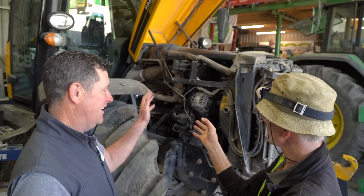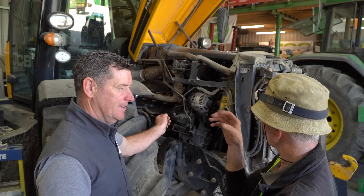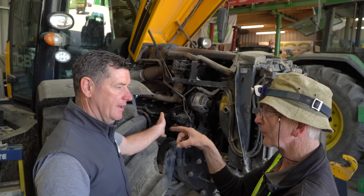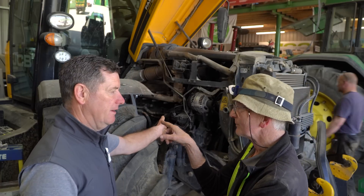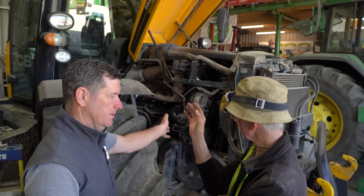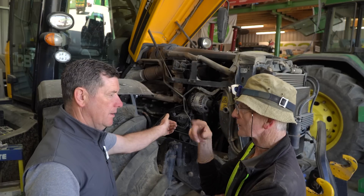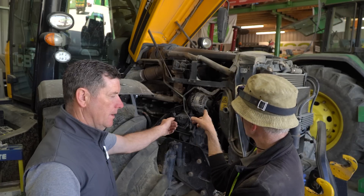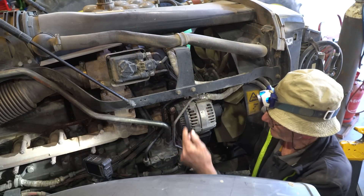We went over to Raviside. John was driving this the night before and it stopped - it wouldn't drive for him. We went over and went to start it and it did actually drive the following morning - started the first time. Presumably sitting overnight the batteries came back up a wee bit. We put a meter on the battery and we were at 10.4 volts - Calum had it up on the screen. And when I checked the alternator, the trigger wire on the back was broken and just dangling around.